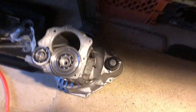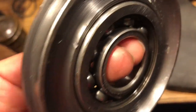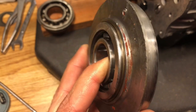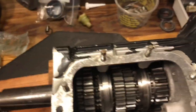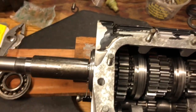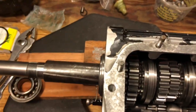Here's our old damaged case and the actual center bearing package — this thing feels like it's got sand in it, a really rough bearing. When it was assembled, the preload was put in between the races such that the ball cage was severely loaded, creating a false tension. As soon as it ran and that bearing wobbled loose, the torque of rotation simply bent the lock tab off and undid the nut.